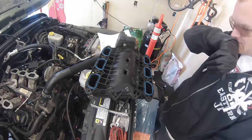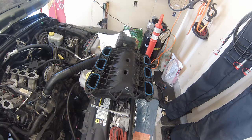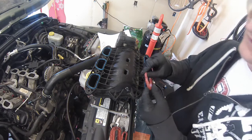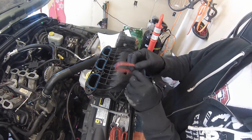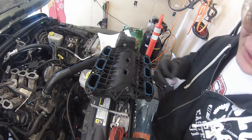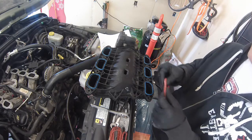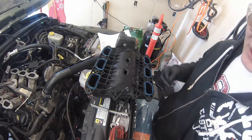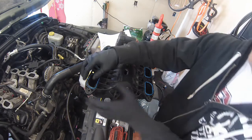Next up, we have our upper intake manifold — this is pretty easy. All we're going to be doing is putting on new gaskets, these little rubber things. They have little tabs on them right there. Just follow how the old ones came out. When you pull these out, put a little bit of oil on them so they're not going on dry, and then put them on just like how the old ones came off.